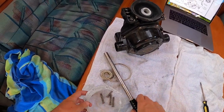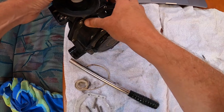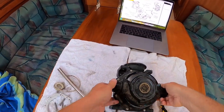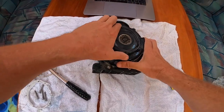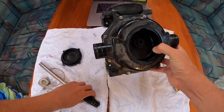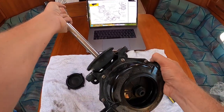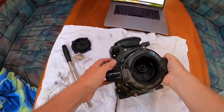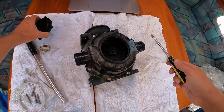So this thing is shot. This is just kind of like a little skirt to keep the water out of the mechanism. You can see here how this corresponds to the exploded diagram — there's the exploded diagram, here's the pump itself. Let me just start off by unscrewing that, and here's the diaphragm on the inside, you know, the handle. The handle moves the diaphragm up and down with this mechanism, but it has no suction — I can hear air going into it. I'm just going to take this thing apart.